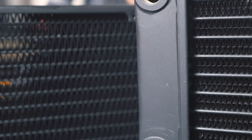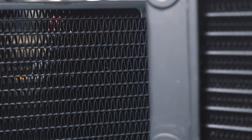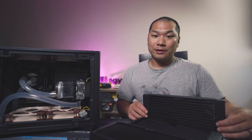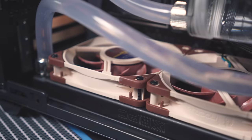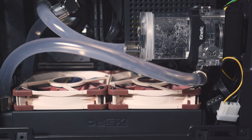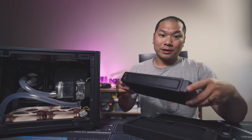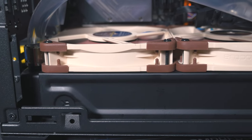This is something that manufacturers often do to optimize each radiator when scaling up the thickness: to balance the static pressure impact on your fan. This will reduce the impact that thickness alone has. Including this variable is very much relevant to custom loop builders because that's what you're going to find on the market at each thickness. These are all 240mm rads. This one is the 20.5mm thick XSPC TX240 with 22 fins per inch. This one's the 35.5mm XSPC EX240, 18 fins per inch. And the thicker rad here is the EK Classic PE240 at 45 millimeters.